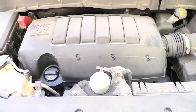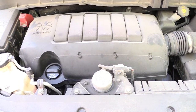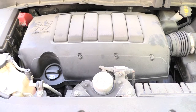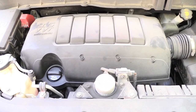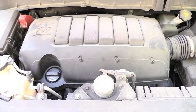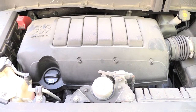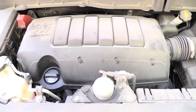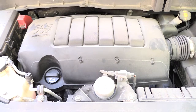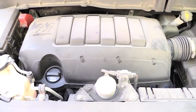What's going on folks? You ever had a problem with your Chevy Traverse — from about 2009 up to about 2016 — as well as your Buick Enclave or a couple other vehicles, where when you put gas in your vehicle and go to turn it back on it won't start up correctly? It'll just sputter, then eventually may start. Most likely your problem is that you need a new purge valve on your vehicle.